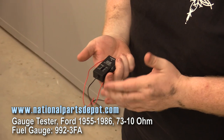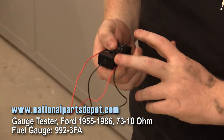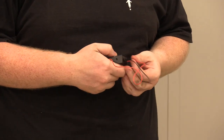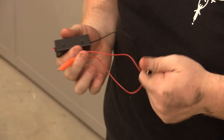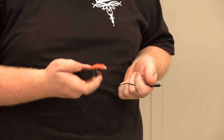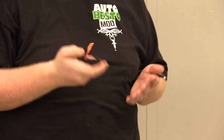This is a little gauge tester we got from NPD. It's basically just a couple of resistors stacked together with a switch that lets you put this in place of your sender on the engine. Pretty simple — you hook your red lead up to your engine wire, hook your black lead up to your ground, turn your key to the accessory position, and put the switch wherever you want your gauge to go. If this makes your gauge work, your sender's bad. If the gauge still doesn't work, your wiring's bad. Really easy, non-invasive, and way easier. Let me go put it on the truck.